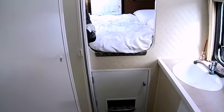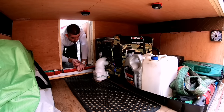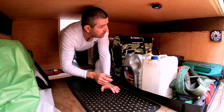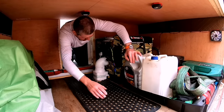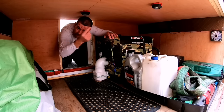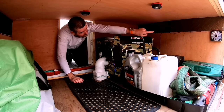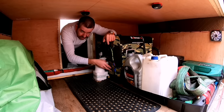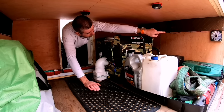Just underneath the bed is the door into the garage. I'll just crawl through there and show you what's inside. In the garage, I do not carry a lot of stuff anymore — I've emptied it out quite a bit. The only things I really carry are some small tools, a green air compressor for the tyres, some oils and the deck chairs. And here we have the generator. This room is completely sealed from the rest of the van so no exhaust gases can leak. It's a pure sine wave generator. I've got extraction fans — one in the corner and two on the other side of the van — which also cool down the generator by sucking cool air from outside.